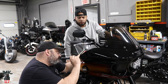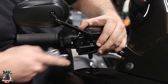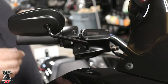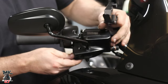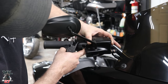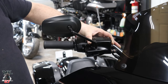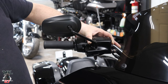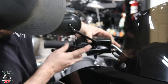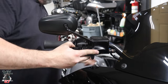Even at three or four — I like four. To get access to the brake lever they just need to loosen up the perch. Now very important — see the white button in there? Make sure the lever is in front of that button — that's your brake light switch. People break them all the time. If you're following behind someone and their brake lights are flickering, it's because they've broken the brake light switch. So when you get the lever in, just make sure it's in front of it, then pop the pin back in.